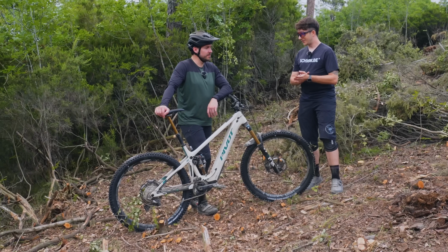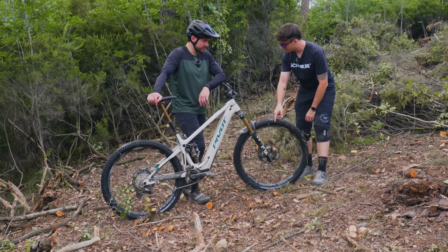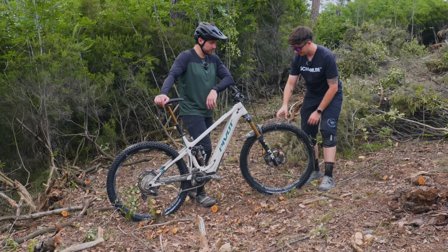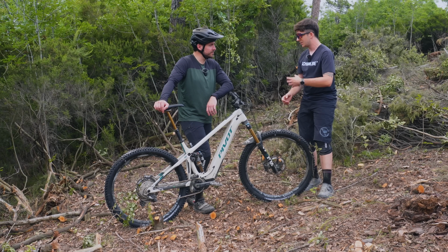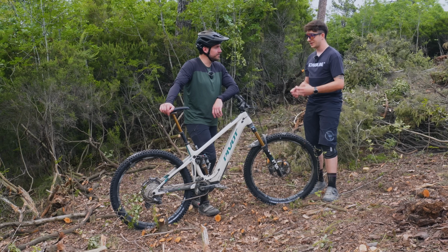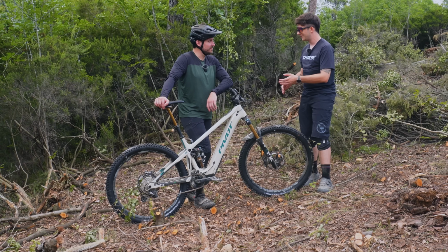Okay. So what it does is you have shorter threads from bead to bead, and when there's a deformation of the tire, it affects fewer threads on the tread. And also, there's less tension on every thread, which enables the tire to react much quicker and much softer to all impacts. That's something we definitely want out on the trail. It's so rough out there, so you want a tire that's always able to conform.